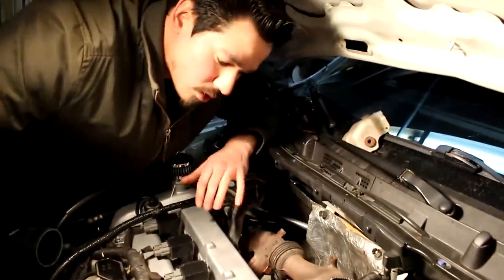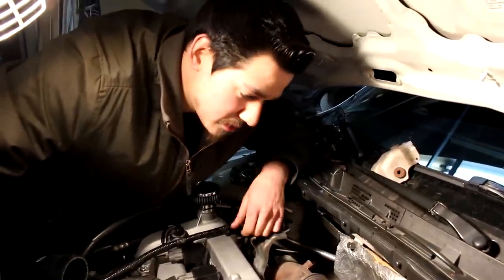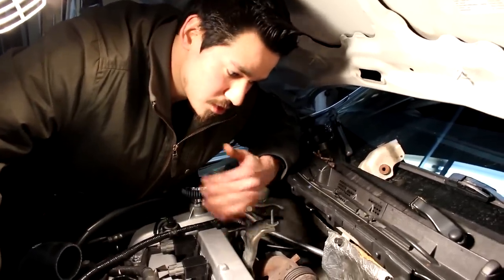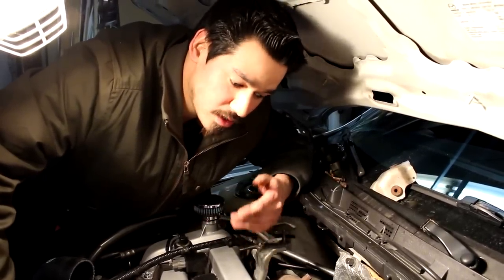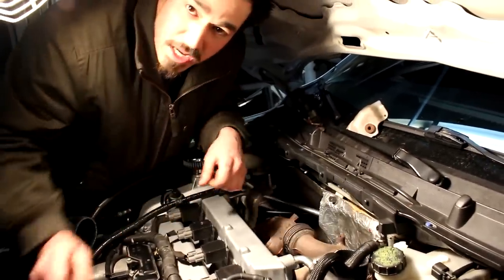And the thing with these cars is, if you're running a lot of power on the stock block, the trick is have a good tune. Make sure you're running a safe tune, obviously. And don't do back-to-back pulls, because what tends to go on these is the ring lands. So even if your tune is super good and right on point, too much heat from back-to-back runs can actually crack the ring lands, because the piston ring end gaps are very tight on the stock engine. So the piston rings will butt together and push down and crack the ring lands.